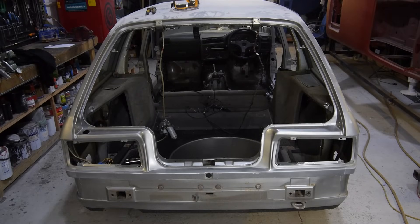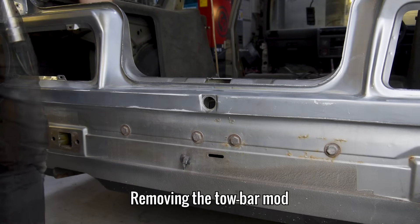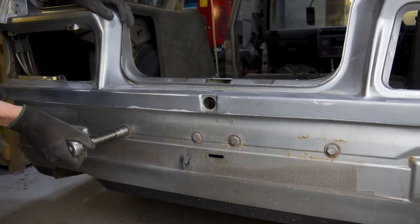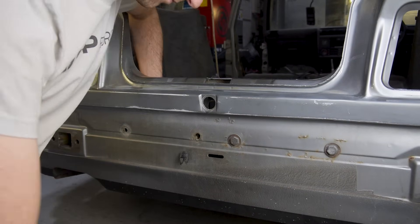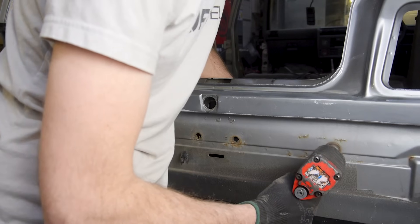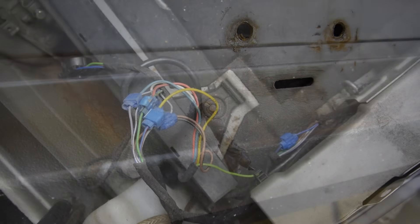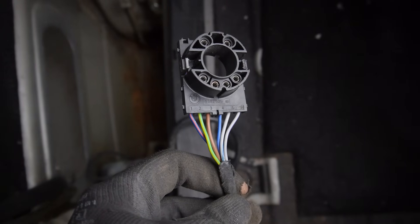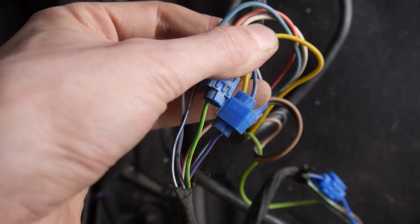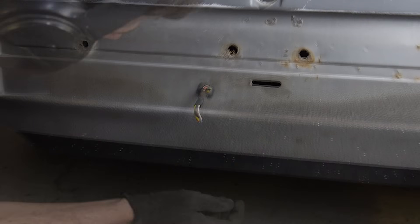And now the boot jam is ready to be keyed for paint. But before I do that, I want to get rid of this questionable modification, starting with these four bolts. With those out of the way, I found out where this cable goes — it's spliced into one of the rear lights with clips that attach over the original loom. They sort of turn one wire into two at the cost of cutting the insulation of both. To remove it, I need to push the cable through this hole and then pull it through the one inside of the boot.